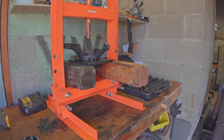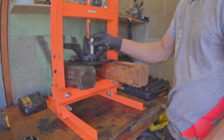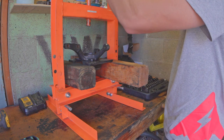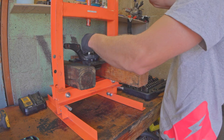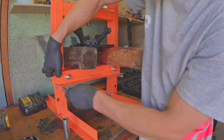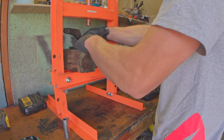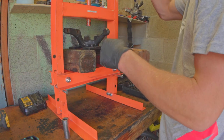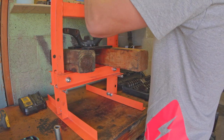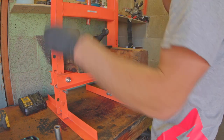Often worth it, depending on how much BS you're trying to do. We're like all the way down on the press — didn't really set the deck height good on this one. Pressing is never like that sketchy, but you are playing with a lot of force — this is a six-ton press, which is honestly peanuts, not a terribly potent machine. Sometimes it's honestly best left to someone who does this day in and day out. I successfully did a set of Lexus wheel bearings somewhat recently, so I'm feeling at least slightly confident.